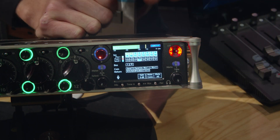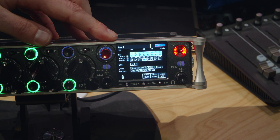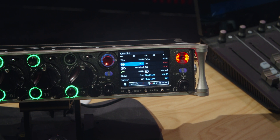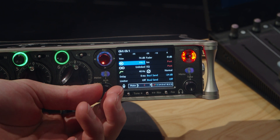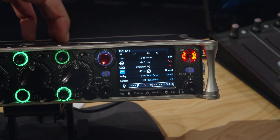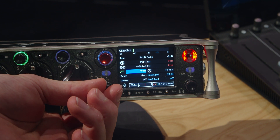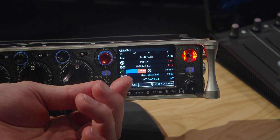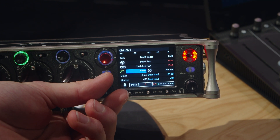You can go to the bus menu and create up to 10 bus mixes. Here's an example of a bus menu — from here you can assign any combination of ISO tracks either pre or post fade. Here's a view of channel one's pre-fader menu — a very familiar experience to those who've used 6 series recorders, but with additional new options due to the expanded, more advanced DSP processing.